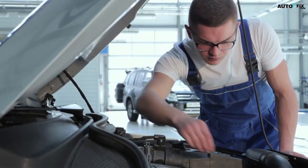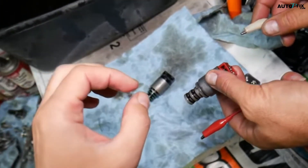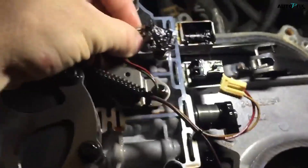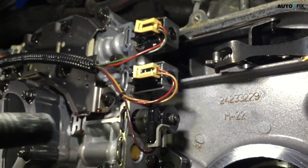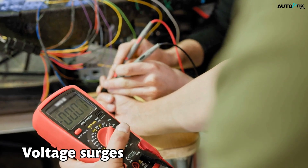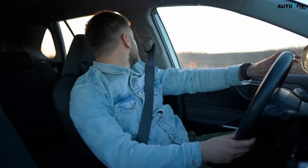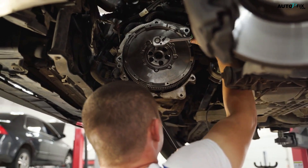But why does a TCM fail in the first place? There are a few technical causes that mechanics see over and over again. One is a faulty solenoid on the circuit board inside the module itself — if that solenoid fails or its connections go bad, the whole module can stop functioning. Heat is another major factor; because the TCM is often mounted near the engine or transmission, it's exposed to high temperatures, and excessive heat can damage or even melt circuit boards. Faulty wiring is also a common culprit, as damaged or loose wiring can interrupt the flow of electricity and data. And then there are voltage surges — if a starter motor or another system fails to regulate voltage properly, extra current can flood into the TCM and damage its delicate integrated circuits. It's worth stressing that driving with a bad TCM is not safe, and knowing how to reset it or when to seek professional help is a valuable skill for Dodge owners.